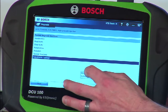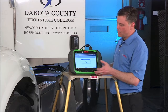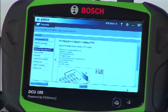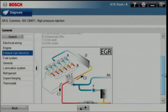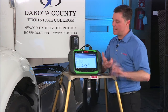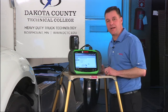Additionally, we can bring up some technical data and get a list of different systems available. We talked earlier about an EGR sensor — let's see what information is available for that. Our exhaust gas recirculation system shows a full-color overview of how that system works. So we now have the ability not only to pull the trouble code, not only to look at data and turn things on and off, but to get a conclusive explanation of how these systems work.